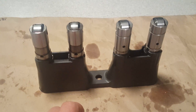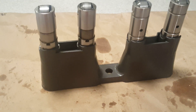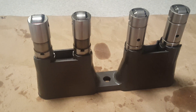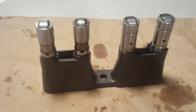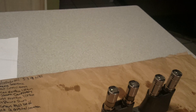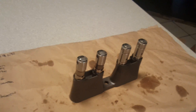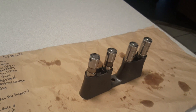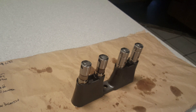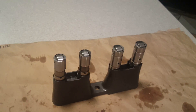And if you're going to put in your old lifters, make sure that you always number everything — cylinder one, cylinder two, three, four — mark it, put them in boxes, make sure it's always in order and you put them back in the same exact spot. Otherwise you're going to have major issues and it'll cost you a lot of money. Make sure you always organize them and put them in the correct location, along with your push rods. Make sure your push rods are in the correct location — they all look the same, but make sure you can see through the top of the hole of the rod and that the rods don't wobble. Always line up the rods and everything in order — never mix those up. Always put them in order and put fresh engine oil on them.